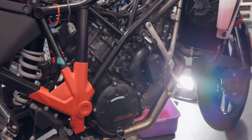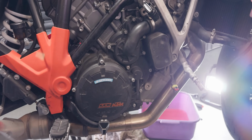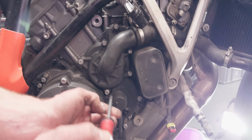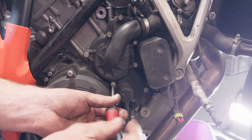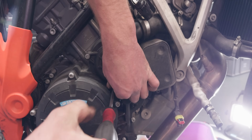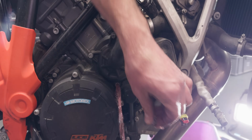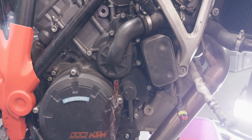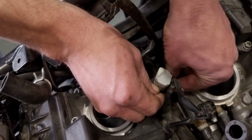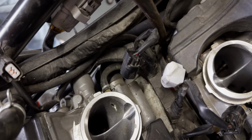As this side is draining, there is another drain plug that needs to come out, and that is close to the water pump. The water pump basically sits right above it, and there's that screw, and then there's the third drain hole to drain the liquid. The fuel hose needs protection. So latex rubber, just keeping it protected so there's no dirt coming in. So the coolant is drained now.